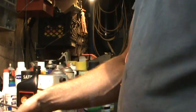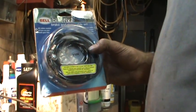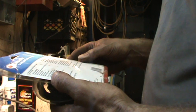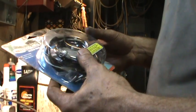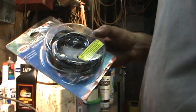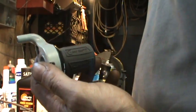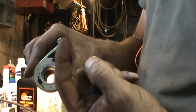I ended up taking this thing right here. This is from Walmart — they sell complete bike cable replacement kits. I think there's four or five cables in here, going anywhere from about five feet long. There are four cables. Some of them are for the brake cables and some are for the shifters. I find the shifter cables are fairly long — about six feet in length — and they have an end on both sides. I look at the one that was already on there, take that, cut the opposite side off, and you can feed it through. It actually ended up sitting right inside there where the cable threaded through, and it came out through here.